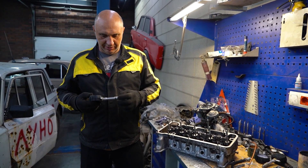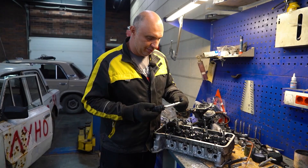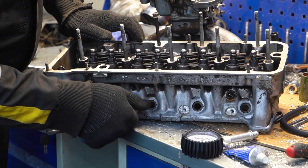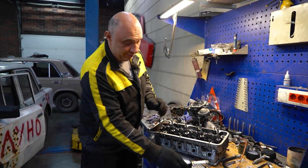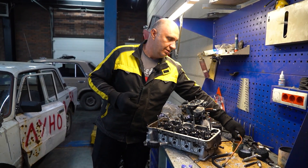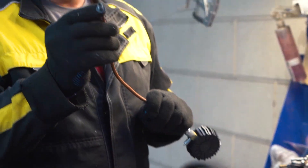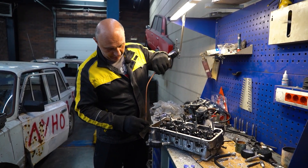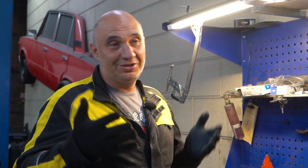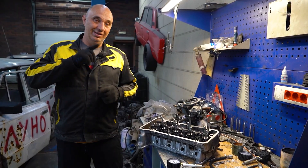Now let's install the compression testers — these have been slightly modified, made a bit shorter, and we fitted some adapters to them. We're going to screw those into the plugs, and the compression testers will be fitted after. We also had to fabricate a copper tube because the distributor is getting in the way on one cylinder. But otherwise everything is ready, so let's commence installation. Once we have all four in there, we'll be able to see the compression inside each cylinder. Let's install them and turn the engine over without starting it.